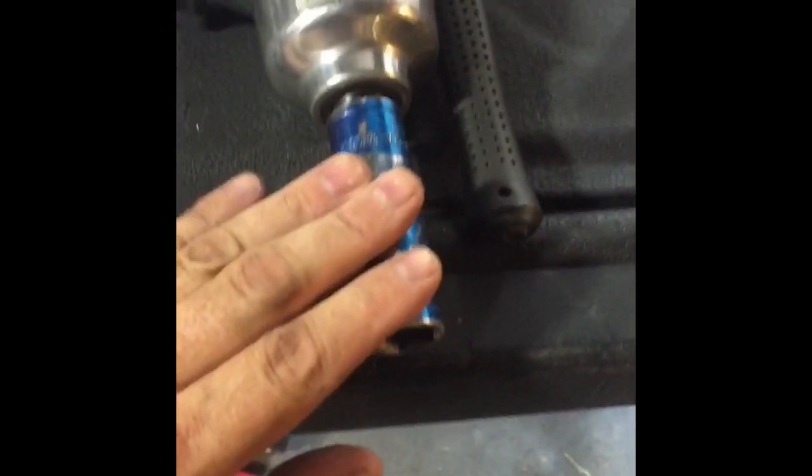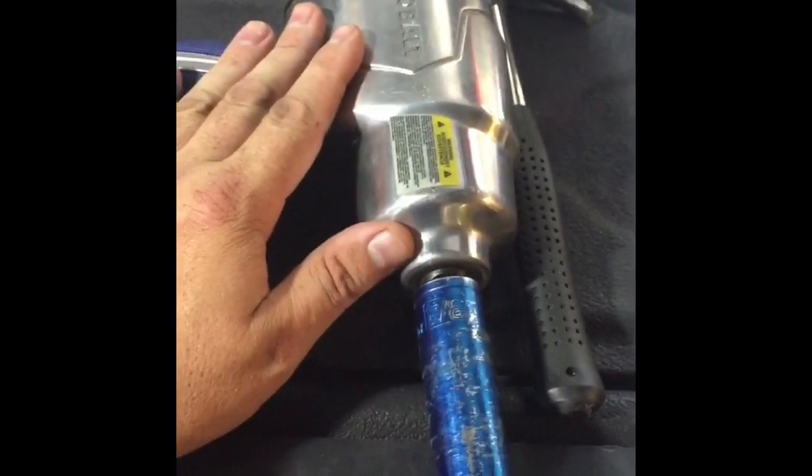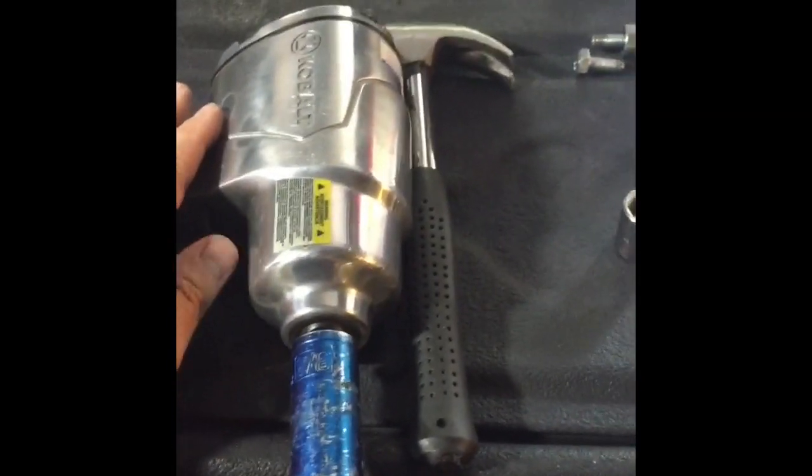Here's a list of tools you're gonna need: a three-quarter inch socket for the lug nuts — I got this attached to an impact, but a regular half-inch drive will do it. A small hammer just in case. You got a 17mm here, this is for all four bolts that hold the caliper on and the piston to the caliper. You're gonna need two of these M8 by 1.25 jack bolts — you can buy them at any auto parts store. These particular ones use a half-inch socket on them.